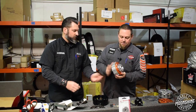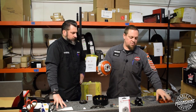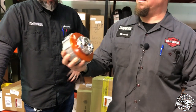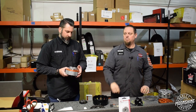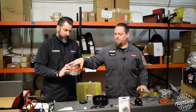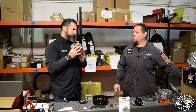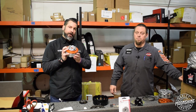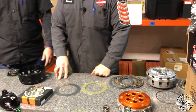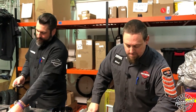We also had a Barnett lockup clutch here — these are pretty much the ultimate. When you use a clutch like this, you get variable spring pressure plus a lockup clamp force to prevent it from moving. This is what you see in drag applications — it screams and will eat all the other setups for breakfast. But this plate is designed to withstand that kind of pressure. If you try to install this in a factory application you're going to have a clearance issue — you'll need to space the derby cover to run something like that.